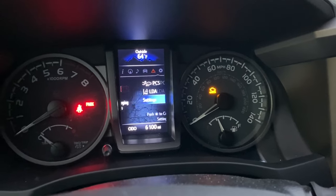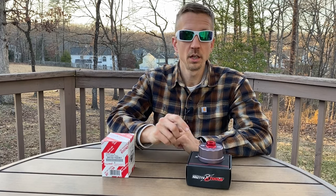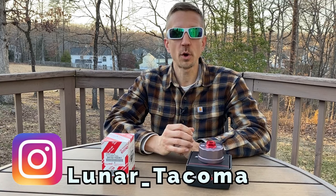Hit the back arrow and scroll to the left on your menu to return to the start. That's all there is to changing oil on a third-gen Tacoma. The process is a little more involved than a typical truck with a screw-on filter, but that special oil filter socket is a true lifesaver. Toyota says to change oil every 10,000 miles, but personally I'll be doing it every 5,000 miles using full synthetic — 10,000 miles is just too long in my opinion. If you found this video helpful, please give it a thumbs up. Thanks for watching!